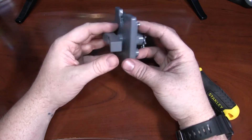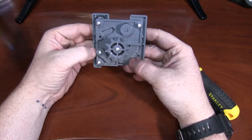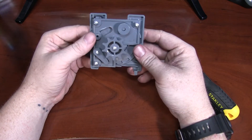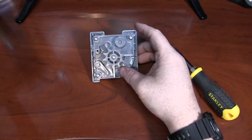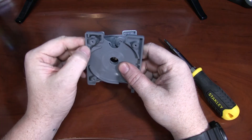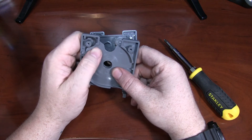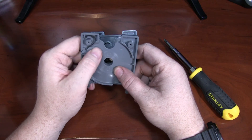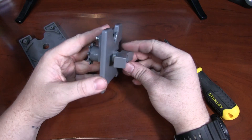So that's the coin mech in a nutshell. I opened this up and cleaned it just because there was a little residue — possibly peanuts — from a past vending that was jamming the mechanism. A couple other possible problem points: make sure the spring is lined up well and not interfering with that nub. If the spring were to work its way down and get caught there, the latch may not positively engage and people would be able to bypass with a nickel, dime, or whatnot. Beyond that, pretty straightforward. We'll have some more videos on different parts as they come around.